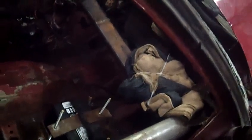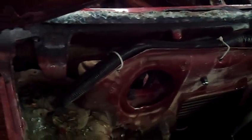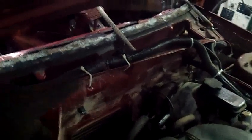Also, I put in the battery box, and I ran my cables already back. I did put it in all by myself. I mean, not that hard to do. It's better with 2, but sucks with just 1. Then I ran all the wires up behind this little cupboard behind the, I guess it's kind of like the firewall. And then I just ran all the wires back down and connected them together. There were a bunch of fuses and wires and everything just connected to that firewall. All I did was just disconnect it all, and then I just stuck it behind it. That way it's out of the way, and it also helps if the motor decides to shift back, it doesn't crush anything. Everything's zip tied down, everything's ready to go.